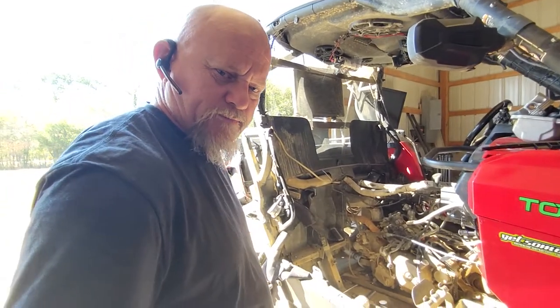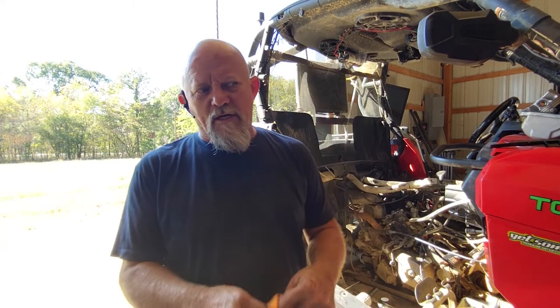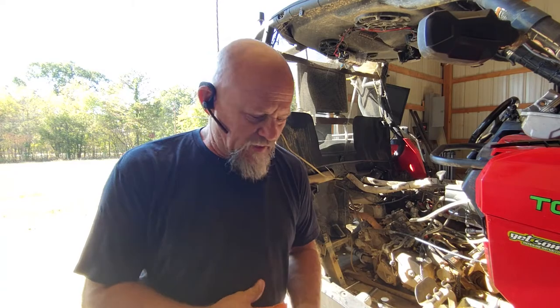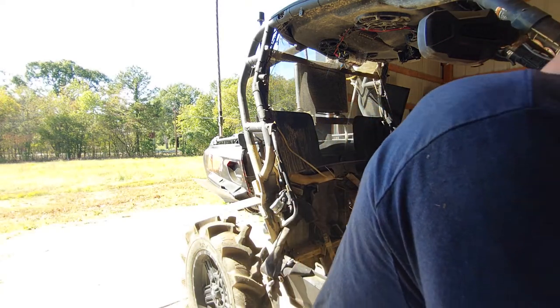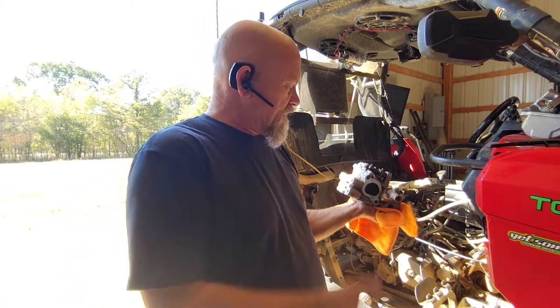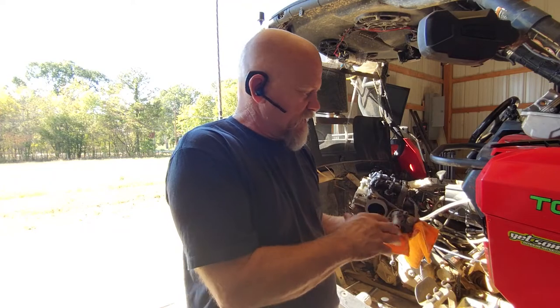All right. Let me get this out of the sunlight a little bit. All right. There we go. So it didn't take that long. You know, if you got all the tools ready and everything's ready to go on these things, you can actually rebuild one in a day or even less. When we're talking about the top end, we're not talking about a total engine rebuild. We're just talking about just the top end. Usually when you do the top end, you don't have to do the head. It's just a cylinder and pistons and rings. That's really all it is.